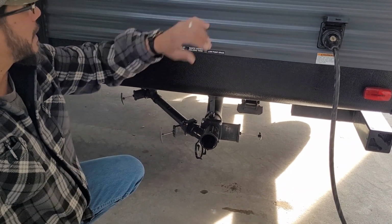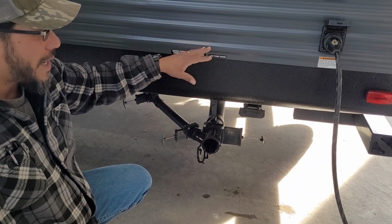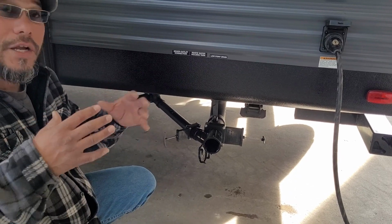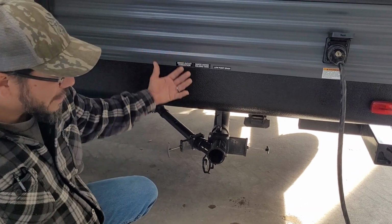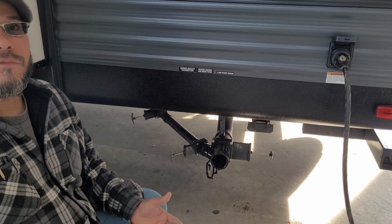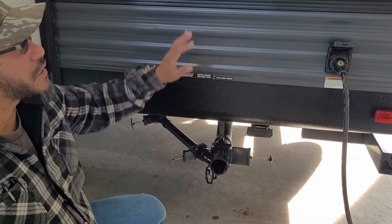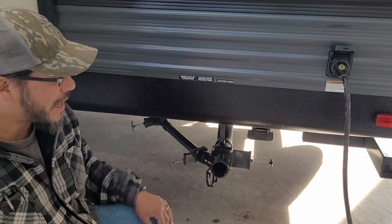Open your black tank up, let it drain out. You'll come back. I think you should have a black tank flush, so you'll use that. Turn that on, and it'll flush out the black tank. It's got sprayers inside that tank, and it'll help clean the sensors and spray the walls, and then it'll rinse more stuff out of there. Once you see that water coming out clear, you can turn that valve off. Once it drains completely out, you close this valve.